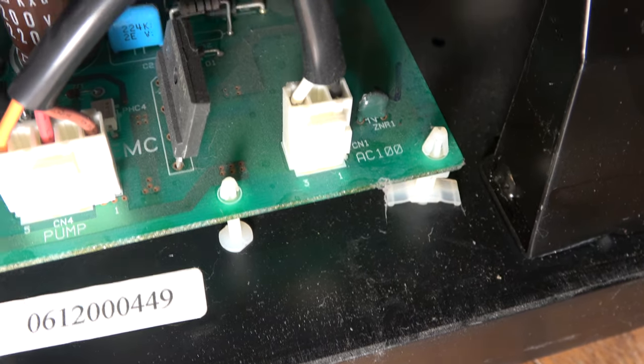Let's reconnect to the main system now. And now we should be able to detect our 5 volts between the green and the blue. And if we don't, then we know there's a problem. I made a mistake there. Between the green and the yellow. Almost nothing. So we have an overload on the 5 volt line.